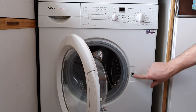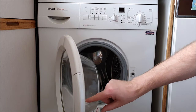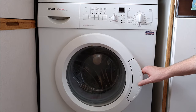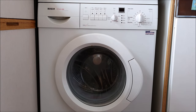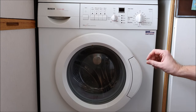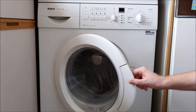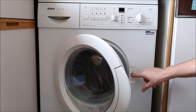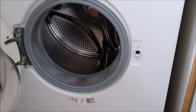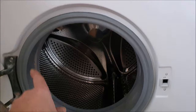Nothing. Try the next step. So I think what's happening is this switch isn't detecting that the door was actually locked, and that's then preventing the machine from starting. I have just been trying to close the door a few times and eventually one or two times I did get the machine to start. So I'm pretty sure now that this is a faulty switch.